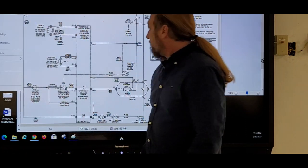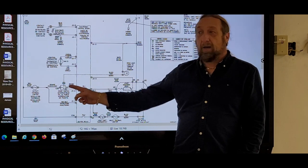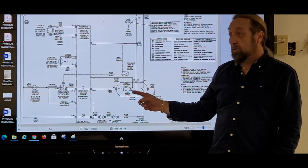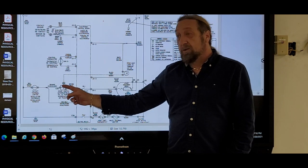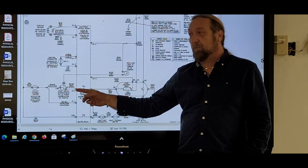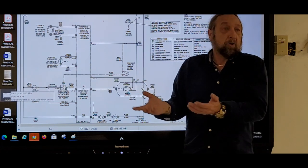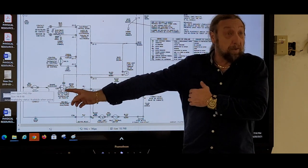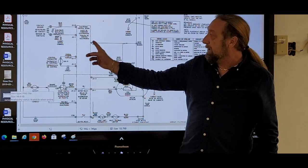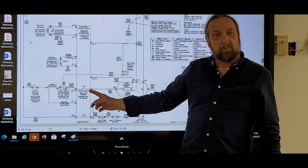So if I go here and here and I don't have voltage, if the door switch is bad, I won't have a voltage reading. If the motor is bad, I won't have a voltage reading. If the door switch is good and the motor's bad, I'll have line one up to this point. But because neutral is broken, my meter will show 0 volts, even though there is line one at that point. That's why we had 1 meter lead on neutral and not here on this circuit.